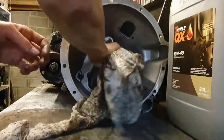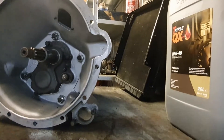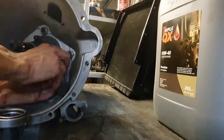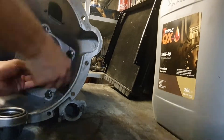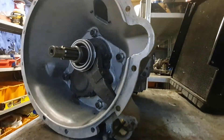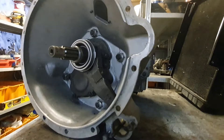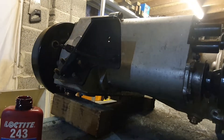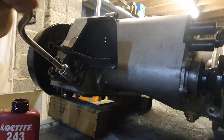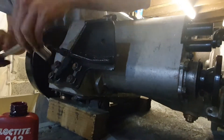A bit of a clean-up, and then I'm going to put the gearbox mounts on. This particular engine assembly — probably being a 4x4 — has four mounting points rather than the three most rear-drive cars have. There's one on either side of the gearbox. There's a clutch release arm, a bit of grease, and a new clutch release bearing. The first mount — the back right — has locking tabs, studs, and nuts, all torqued up tight.